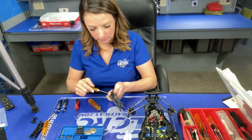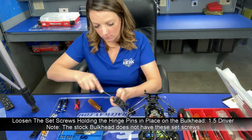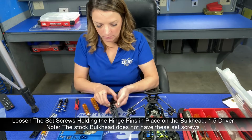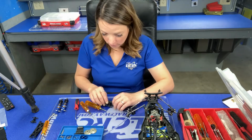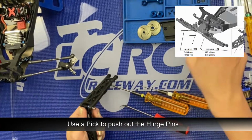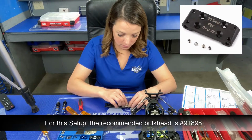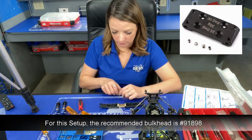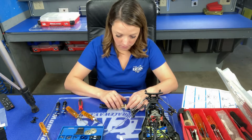And I'm loosening the set screws that are in place to hold the hinge pins in place. Those are not going to be in place if you have the stock bulkhead. It's only an aftermarket. Now I just used a pick to pull out those hinge pins, and I'm going to be reinstalling a bulkhead. The recommended one for this setup sheet is a 91898. There is a link in the description to all the parts I talk about today.